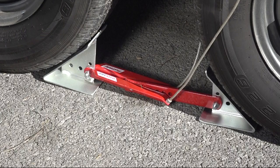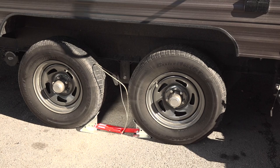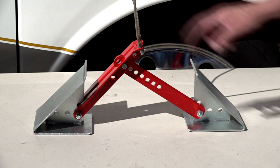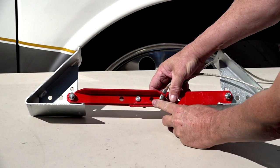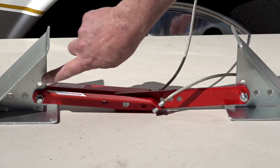When the chock is installed it prevents the trailer tires from moving in either direction. To remove the chocks, grasp the handle firmly in the middle and pull upward. To lock the chocks, step the chock into place tightly between the wheels. Place the padlock through one of the empty holes in the center of the arms or through one of the lock holes in the wedges just above the scissor arms.